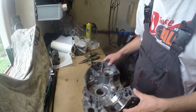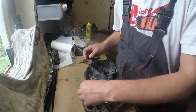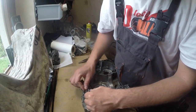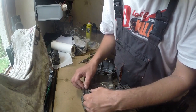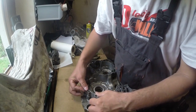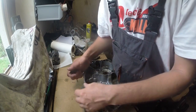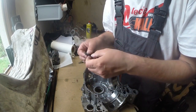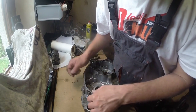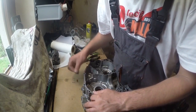Hello everyone, this is the Aprilia SXV full engine rebuild movie. This is the first part, in which I prepare cases to join together. As you can see, I have some old sealant on edges which I have to remove. This is important to do, as the surfaces have to be perfectly clean and without any sharp objects